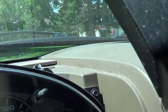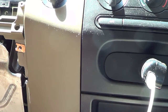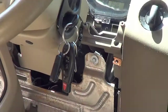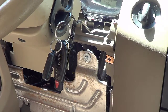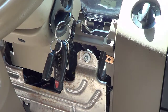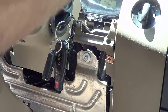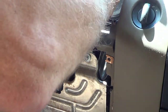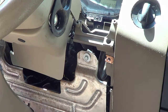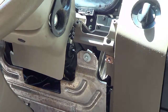I picked a very hot day in July to fix this truck. The lower panel requires the removal of two 7mm hex head screws. The upper panel requires two more screws to come out, and then the instrument cluster has four screws to come out. I apologize for the camera angle — I was really busy trying to get this thing apart and doing it by myself with no camera person present. On the back of the upper panel there is a small cable assembly that can be pulled out to make it easier to remove. The instrument cluster itself has the gear shift indicator assembly that removes from the bottom by depressing two little interlock tabs and pulling it straight down. Once that is done the instrument cluster is free and you can take it downstairs to work on the electronic section.